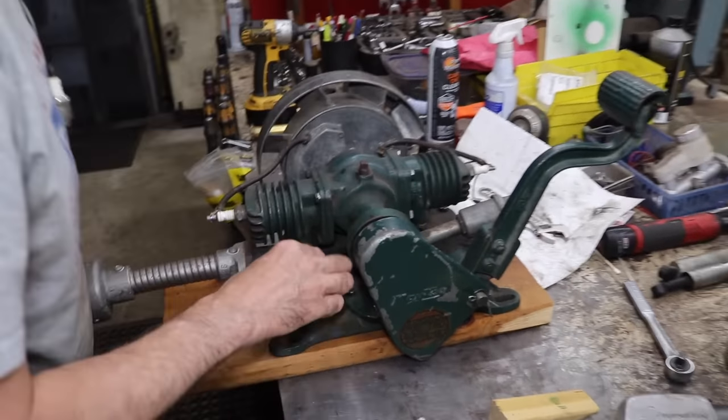Now they tell you in the book, because this is just pipe threads on here. It's like half inch pipe threads. That's like a pipe nut to adjust this thing. So when you have it running and you have it on run, this should be right up and down. So as you're tuning it, say it's over here, then you loosen that nut and you turn this so it's up, and then you tighten the nut down. So I may have to do that to adjust it, but now it'll tighten up again. So we can fill it back up with gas.